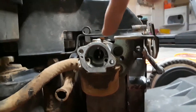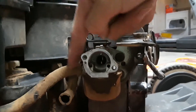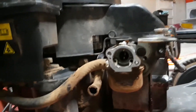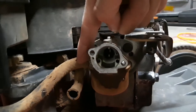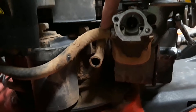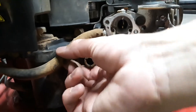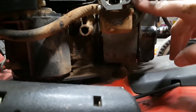Next, right here is the actual carburetor and it looks really dirty, so we're going to clean that up. You want to remove the gasoline hose that goes into the carburetor. Go ahead and take a look — it's just held by a clip here. You just want to unclip that and move it to the side. If you do have gasoline in there, you might want to plug that up at the end of the hose or use some kind of clamp, but be careful with an older hose — you don't want to tear it.